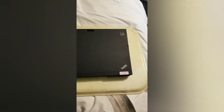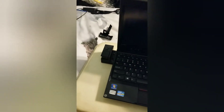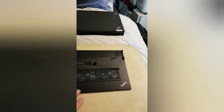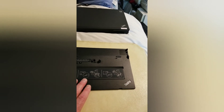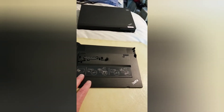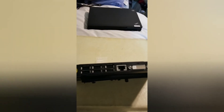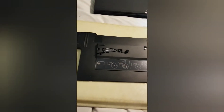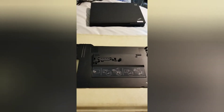This is an X230T that's now docked up on here, and you can see where before it would not have fit with the guide fence and rail on there — it now fits pretty good and it actually looks fairly professional. This is an X230T tablet computer, and when you go to put this one on the dock it takes a little bit of hunting around, but if you remember where it has to be positioned you can make a pretty easy job of it. One downside to using this dock for the X230T instead of the ultrabase is this doesn't give you the DVD optical drive slot that the ultrabase has, but you can always hook an external DVD to one of the many USB ports on the back. This dock also has eSATA and USB 3.